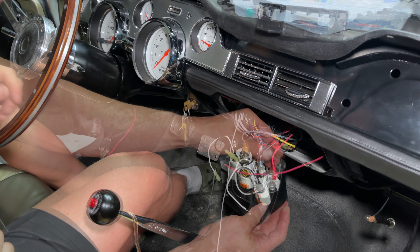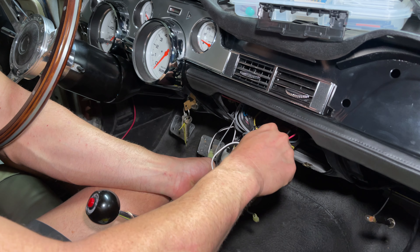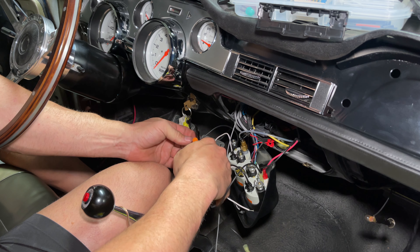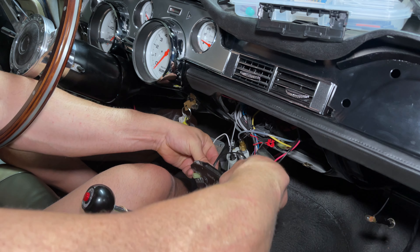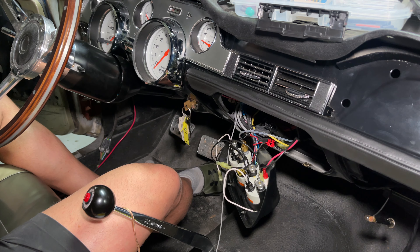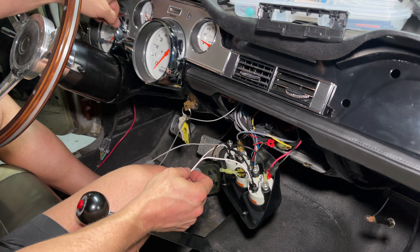Click the ignition wire to the eye. Now I'm going to get creative — I'm going to pull the ground off the other light that I did and ground that to the right style of connector. I'm going to put that to the ground pin that grounds out our 12 volt. All I'm going to do is take my two lights, chop off the connector I put on yesterday, hook my two grounds together, and put those in there. So now I'm just going to hook the two ground wires from the lights and jump it off the back of my other gauge. All of our grounding is done.